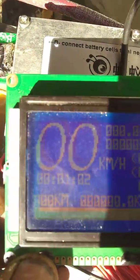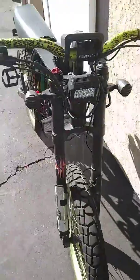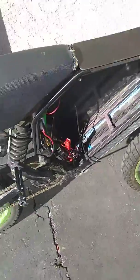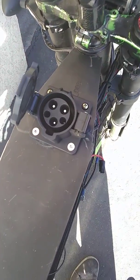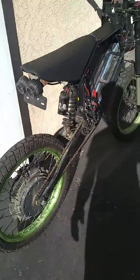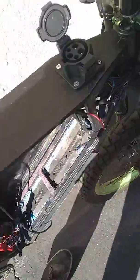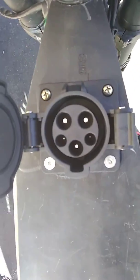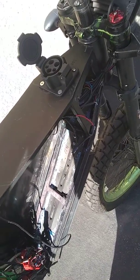Just like a Tesla. I got that working right, and another addition I'm going to add to the bike is J1772 charging. It'll have an onboard charger and I'll be able to roll this thing up to an electric car charger and charge up at six kilowatts, which is significantly more than the house plug I'm using now. So it should fast charge the battery — I could drive it across town, go to Carl's Jr, charge it up, and keep going. I love this bike. Happy Saturday!